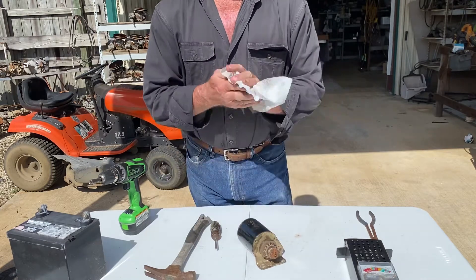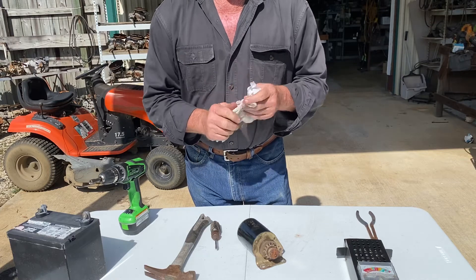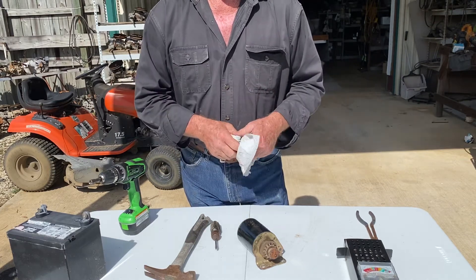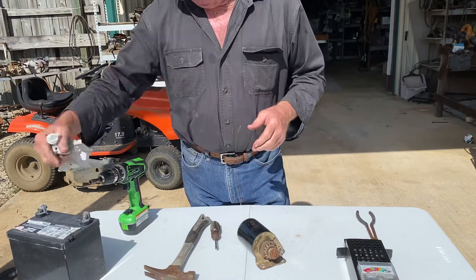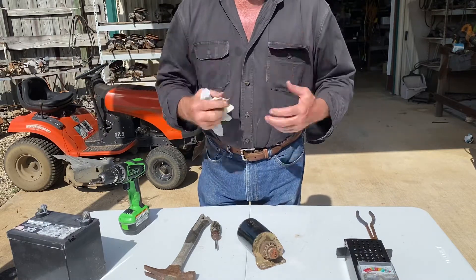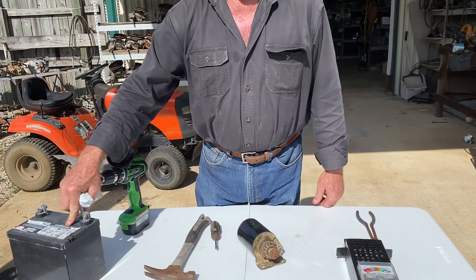What I want you to do is take out the spark plug in the motor. When you take out the spark plug you release the compression on the engine. It'll tell you a whole lot — it'll tell you if the battery is weak. If it turns over real slow and doesn't sound like it's got any power or momentum in it, it's gonna be the battery. I see a lot of problems with the battery.